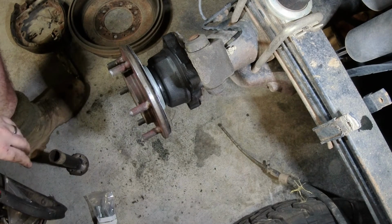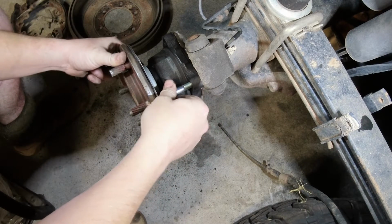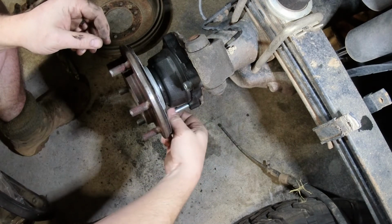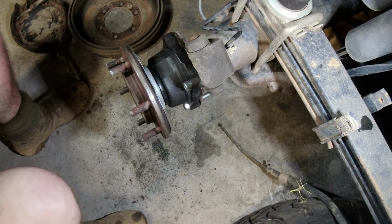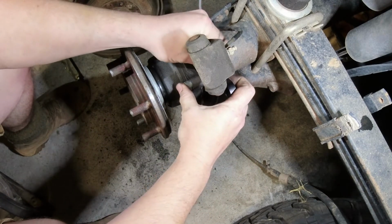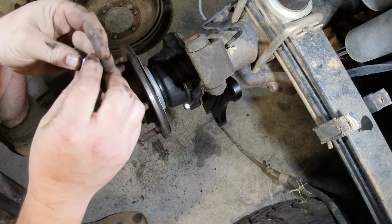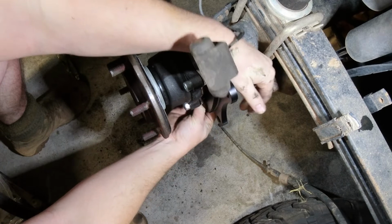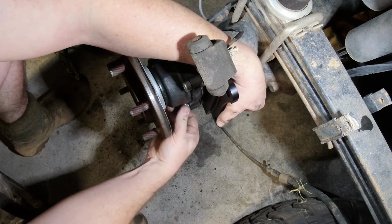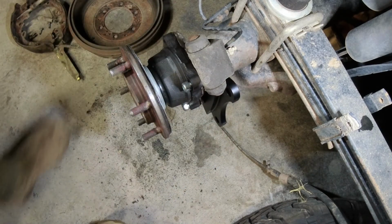So, in the kit comes with some new bolts, because obviously you're adding extra material on there with the bracket. You need longer bolts to take up the extra meat that you've got on there. And once again, these are cone lock nuts, so they're not going to come off. And unlike nylock nuts, if it gets super hot, the nylon part is not going to melt out and cause them to come loose. Same design nut as what you find in a lot of exhaust manifolds.